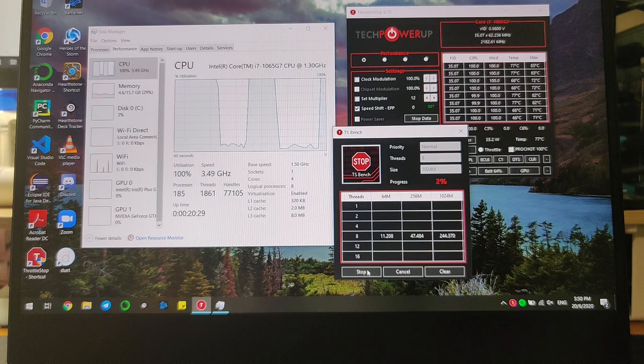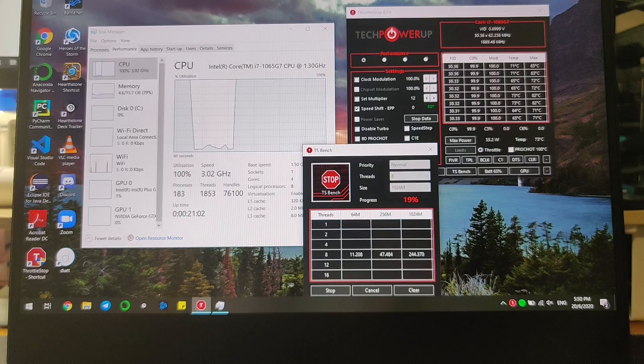For the stress test, I'm using ThrottleStop to test the speed and as you can see it hits 3.5 GHz. It never reaches 3.9 before being thermally throttled down to about 2 GHz because the CPU is capped at 25 watts even though it can boost to 33 watts. But the temperatures never hit above 86 to 87 degrees. So I feel that Razer could actually make this run a bit faster and allow for a little bit more heat, because there's a lot of thermal headroom as you can see in this test. As for the fan noise, I don't hear anything — I'll stop talking and let you guys hear it. I also don't hear any coil whine, which is a good thing.